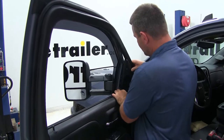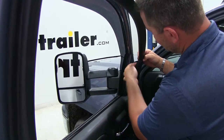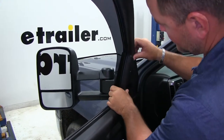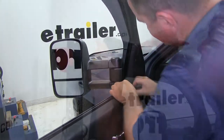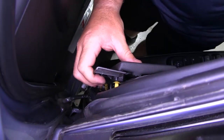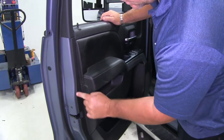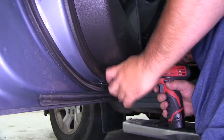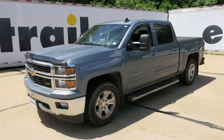Now we can remove our tape. We're going to slide our panel back in — there's a lip right here on the side and we want to get it around this edge, going around and making sure that lip is all the way around all of it. Then make sure you push that fastener back in, and we can start putting our door panel back. Just go around the edge making sure it's all popped into place. Once that's done, replace your two screws at the bottom. That'll do it for a look at and installation of the K-Source Custom Extendable Towing Mirror, part number KS62148G, on our 2015 Chevrolet Silverado 1500.